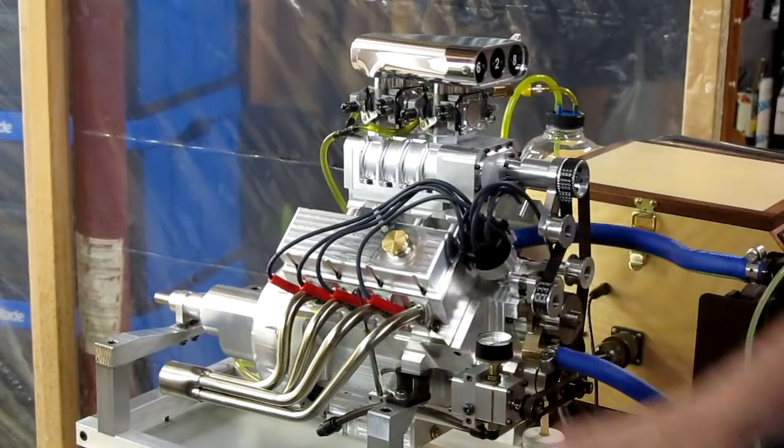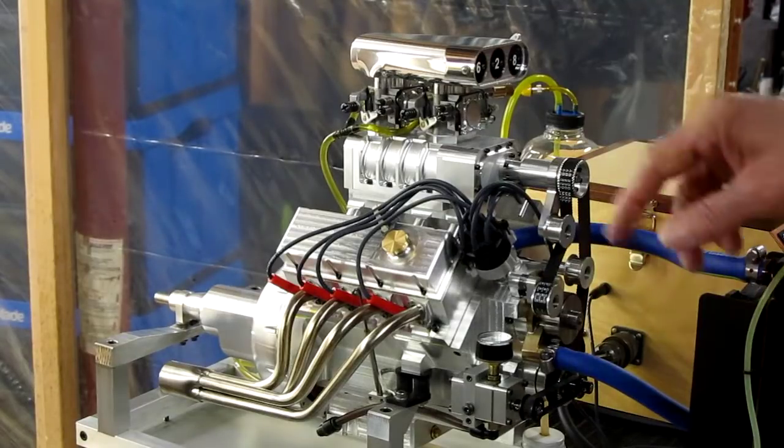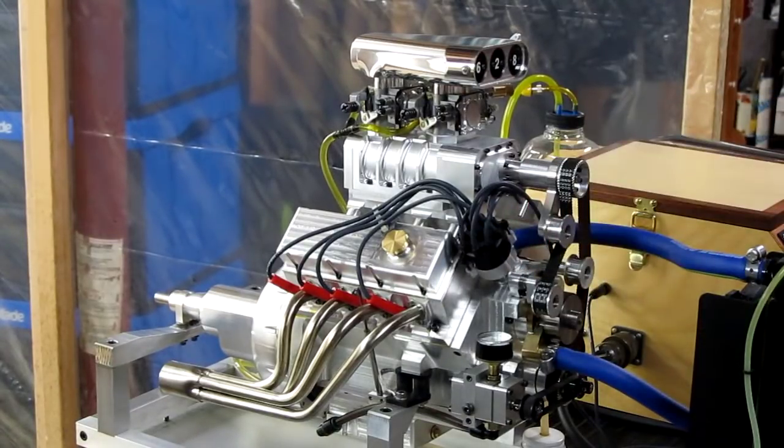The headers are pretty straightforward — they're made out of stainless steel and they look cool. The distributor inside has an old-school type mechanical advance that is calibrated to give about zero top dead center on the timing at idle, which is about 1200–1500 RPM, and at top end around 8000 RPM we're getting 30 degrees before top dead center on the ignition timing. It really helped the performance because you can get good performance at idle or top end with fixed ignition, but you can't get good performance on both. So the mechanical advance really helped.